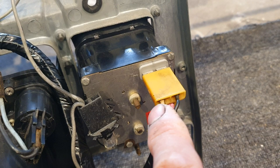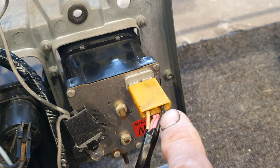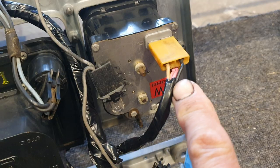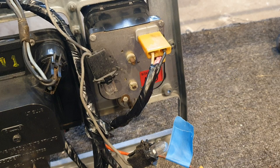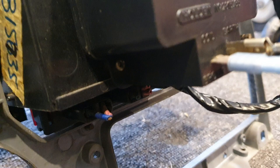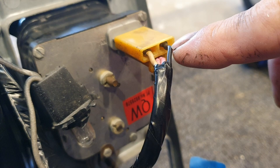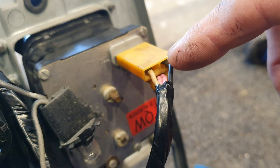This was the original fuel gauge connector. All I had to do was leave the tan wire in there. The pink wire was up here — I moved that lug. This was a black negative wire which I've just cut and joined to the blue oil pressure sender unit wire, which used to go into the bottom of the old fuel gauge. As you can see, that blue wire was just going to the warning light — I just cut that wire and joined it into this black wire here.